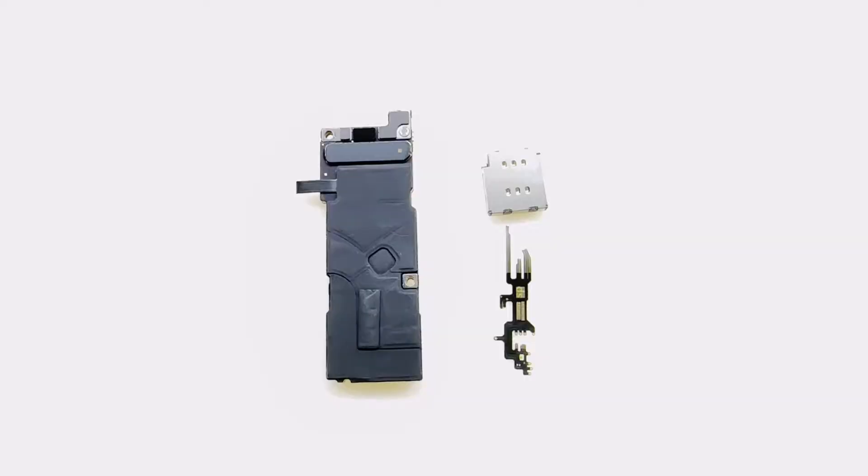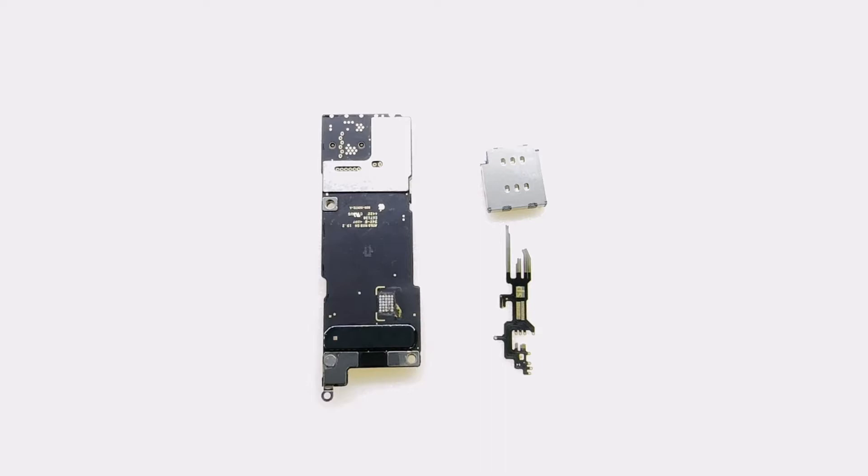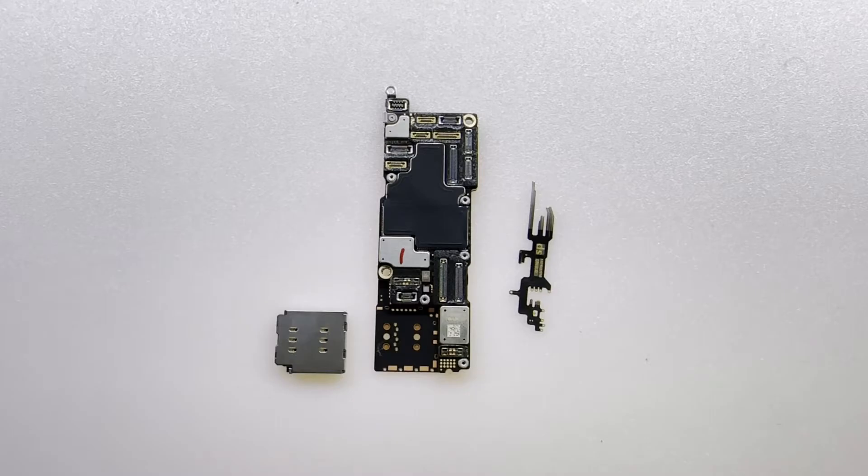This is an original unmodified iPhone 14 Pro Max motherboard. After removing the graphite film from the surface, we find a MM-wave antenna. The MM-wave antenna is not needed for use in Shenzhen, so we remove it. We plan to solder the dual SIM tray to the lower left corner of the motherboard and solder a flex cable to the back.